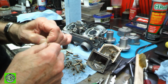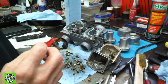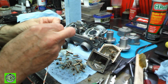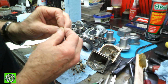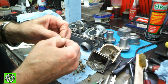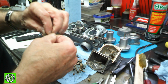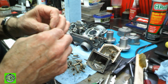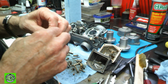And it's not really abrasive. It doesn't hurt the jet. People who try to drill them completely ruin them. These are precision cut pieces. This is not some huge engine that can take a lot of extra fuel or whatever. It's designed to have a X amount of fuel and be very, very well metered. Again, one cylinder is only 200 cc's. So just carefully go through each and every one of those jets, clean out any gunk in there, make sure it's smooth and you don't feel any junk coming out, and then clean them out with carb cleaner or whatever you're going to clean them with, and you will save the jets and not have to worry about it.